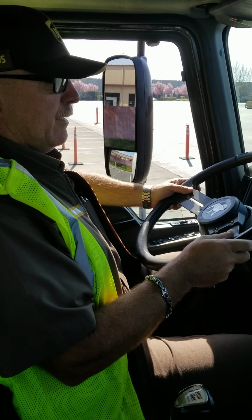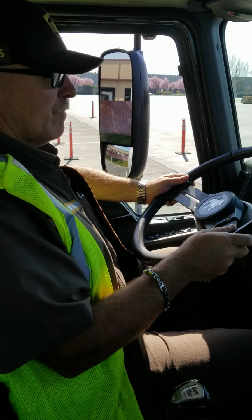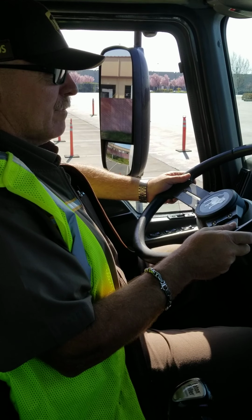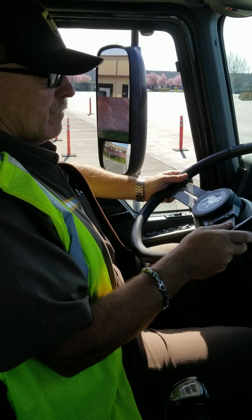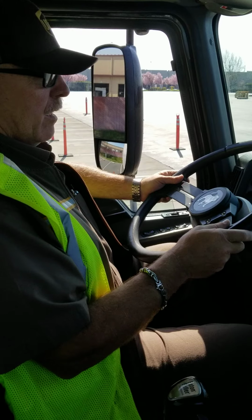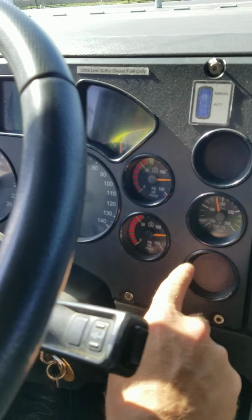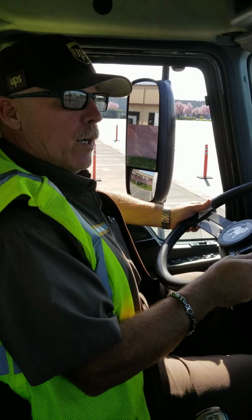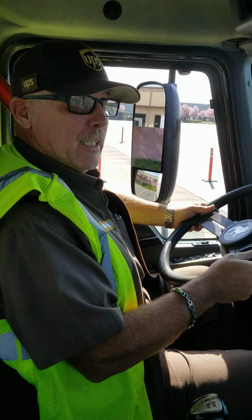The needle is still rising. It appears that my needle has stabilized at 121 psi. My cutout air pressure is 121 psi. I'm now going to perform the applied leakage test.